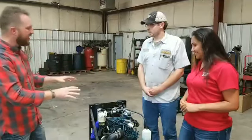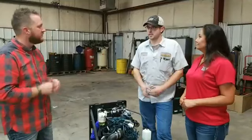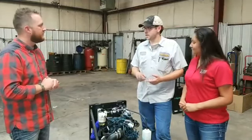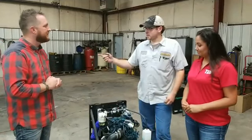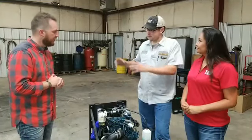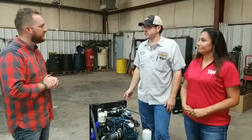So I know we have the diesel powered unit, but there's also the electric unit. Talk a little bit about the electric unit and the advantages of that. Yeah, we sell the Night Phoenix and the Night SSI, which I think is Space Saver. The way we do those is we install 4 extra Trojan AGM deep cycle batteries in the back of the truck, either in the frame or on the frame. Tie them into the truck batteries, so you have 8 batteries until the truck batteries get to, I think it's 12.8 volts. Then the truck batteries shut off, and it runs on auxiliary batteries for the rest of the night. And you're seeing anywhere from 10 to 14 hours runtime on those air conditioners.